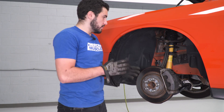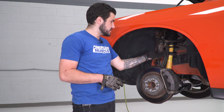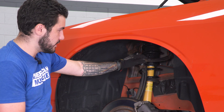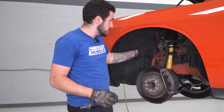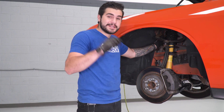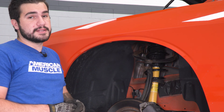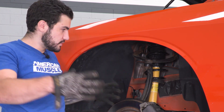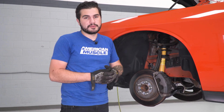Kicking off the uninstall — all you're going to have to do is disconnect the ball joint from the upper control arm to the suspension assembly. This is going to be an 18-millimeter nut. Once we have that taken care of, this will drop forward and we can remove the two bolts holding the control arm to the body of the vehicle. There are two nuts on the inside behind your springs with a little tab so we don't have to worry about getting a wrench on there. The bolt heads are actually under the hood inside the wheel well on both sides of the inner fender.